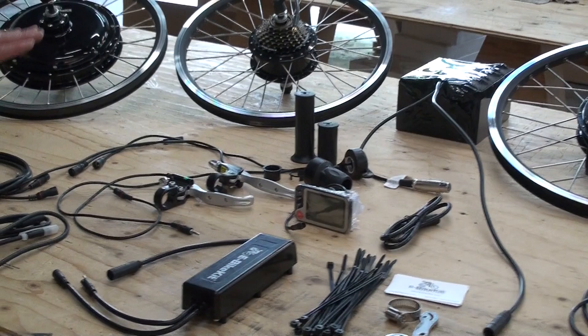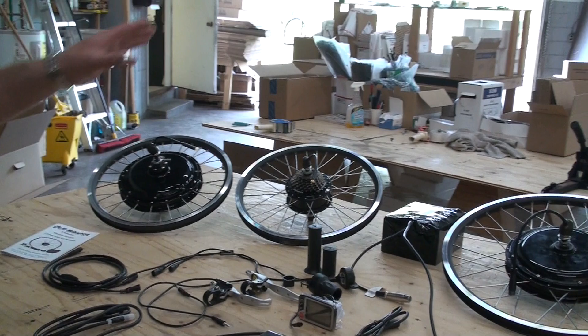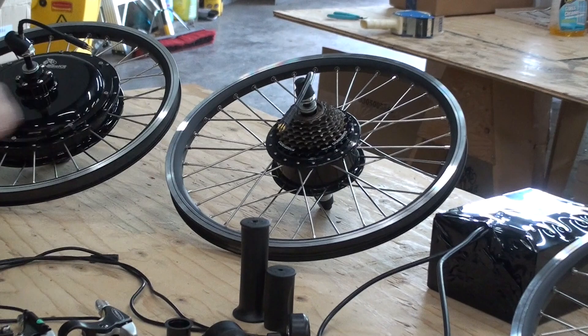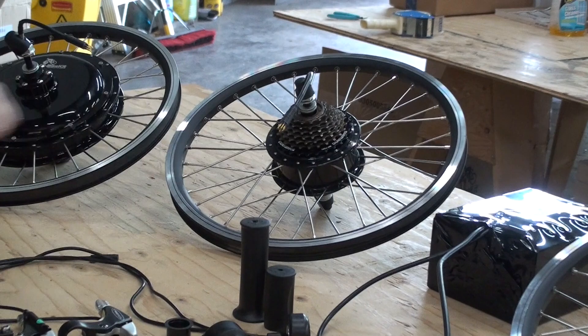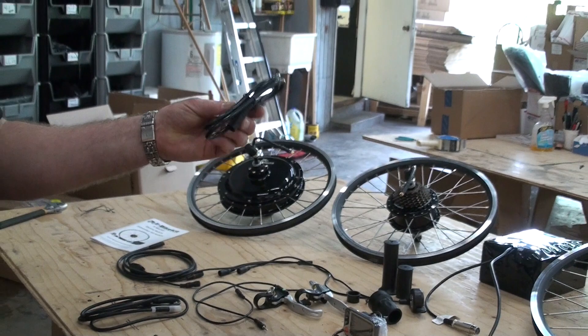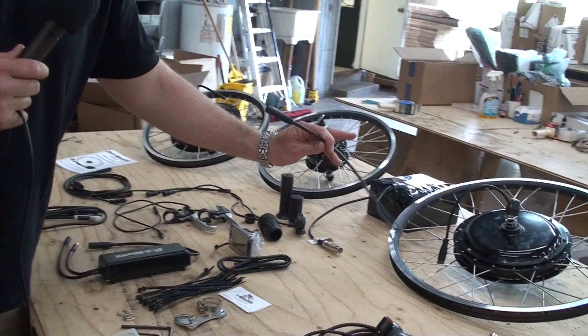Back here we have the two motors available right now, which are the 500-watt direct drive — that's basically the heavy-duty option. Anything over 200 pounds, anything where you want the kit to do more of the work than your legs. If you're more of a cyclist who plans on pedaling a lot and wants a lighter-duty application, that's going to be your geared motor — under 200 pounds, light-duty. Those two motors work with these kit components, completely modular, with troubleshooting on the LCD if there's ever a problem, and modular so you can replace any part that may be faulty. Every kit comes with a battery wire harness — whether or not you get our battery, that harness plugs into your controller.